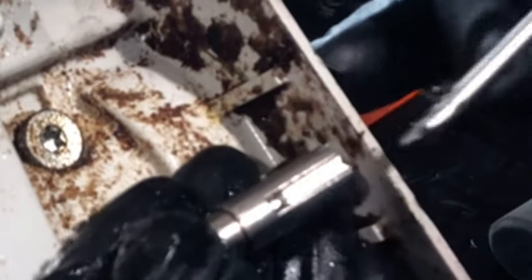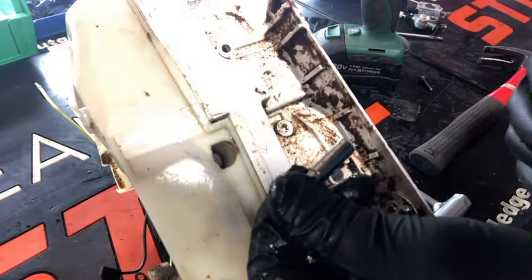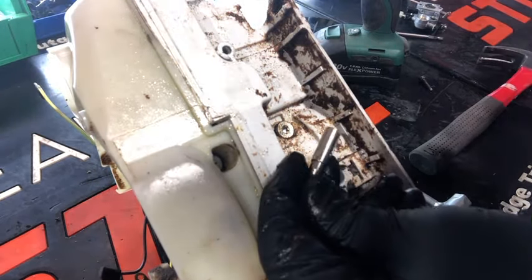On the side of the oil pump there's a slot and some holes — that's going to be where oil comes out. When you reinstall this you have to make sure that it's aligned properly in the hole. To get this realigned right, make sure you pay special attention when you're removing it so that way you know how to reinstall it.